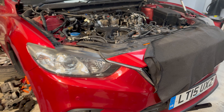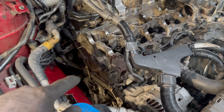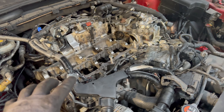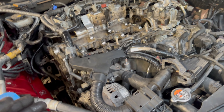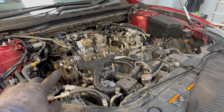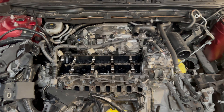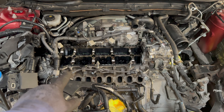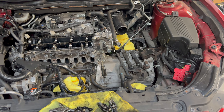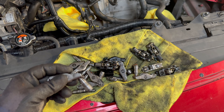Have a look at the difference - hopefully you'll be able to see it. Very clean, the top as well. This one still needs the timing to be installed on it and obviously the camshafts and the top end parts and the bottom end because the oil pan is still off. We assume this one will be ready by around Wednesday, and with that one the EGR cooler is cleaned. I'm going to assemble the parts back together very lightly today and I'll talk a little bit later about the rocker arms and the tappets.